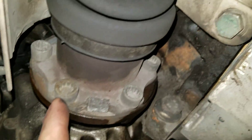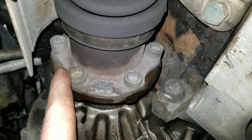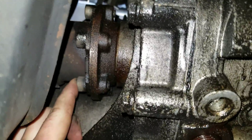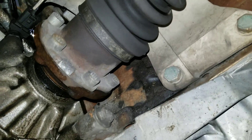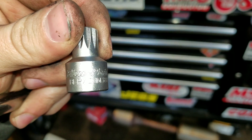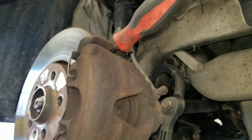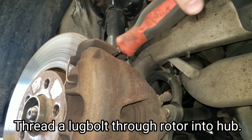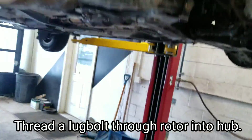Looking under the car, the next thing I'm going to do is unbolt the axles. You will need a specific triple square tool if these are the factory axle bolts. There are six axle bolts on the driver side and six on the passenger side. If you're doing this job by yourself, the easiest thing to keep the axle from spinning when you loosen the bolts is to stick a screwdriver in the slots of the rotors — that holds the axle in place while you break them loose.